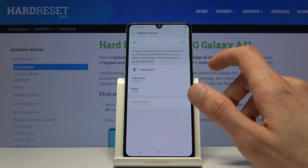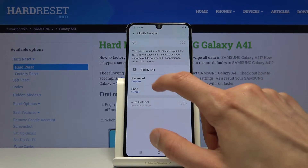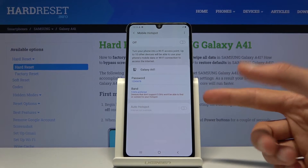The 2.4 GHz will be accessible by a wider array of devices. When you select 5 GHz, it even gives you a warning that devices that don't support 5 GHz won't be able to find or connect to your hotspot. So if that's the case — if you don't see your network in your Wi-Fi list even though it's on — come back here and change it to 2.4.